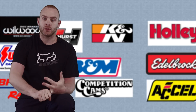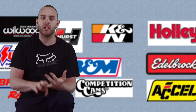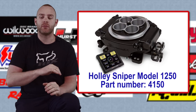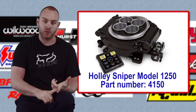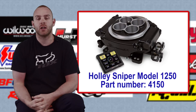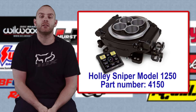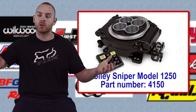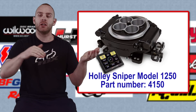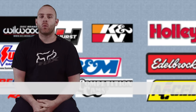On top of this you can put a carburetor or an EFI system. For ease of tuning and drivability we went with EFI — we called Holley and got one of their Sniper 1250 kits. It looks like a carburetor but it's a full functioning EFI fuel injection setup. You can tune it with a laptop, it'll tune itself, and you just bolt it on, answer a couple quick questions, and start it up and drive. This kit works on motors from 400 to 1200 horsepower, so you can start with 500 horsepower and grow into it — add boost next year, more boost the year after. You only have to buy it once.